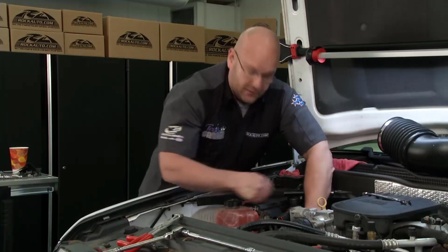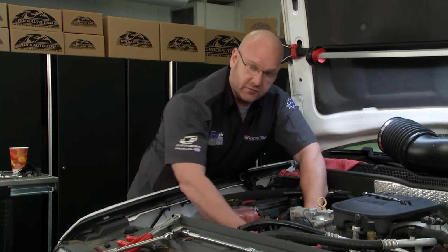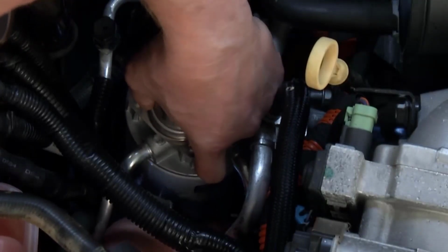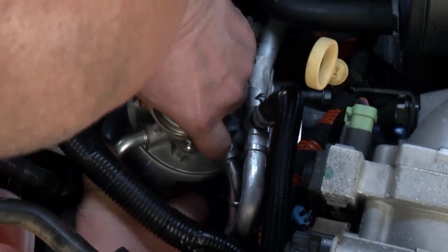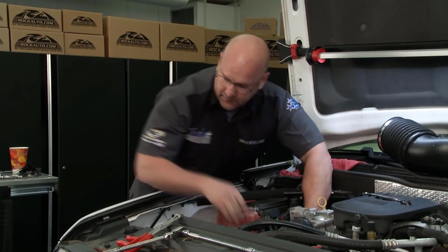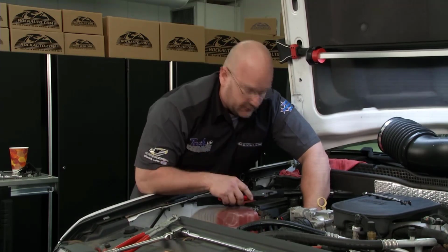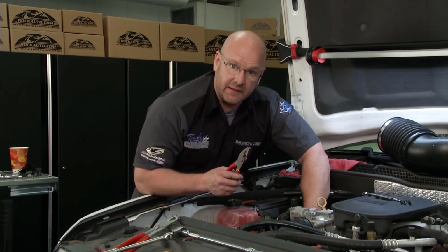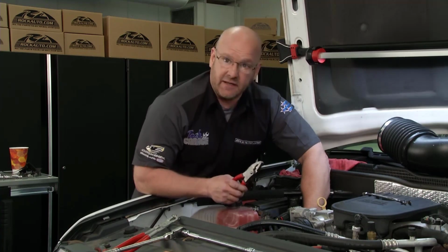Now I cheated, I put a little bit of silicone lubricant there so they'd slide up on you. Want to cross that shoulder, you got to get the clamps right. Last thing you want is any kind of a leak. Let me work with one here, get it started up over, and then I'm going to have to use fancy pliers to get it on. I'll get this on, I'll get the whole assembly remounted. Down at the bottom, we'll reconnect the connector. I'm going to use a little dielectric gel there because it's down in the moisture behind the suspension. Make sure that's all good.